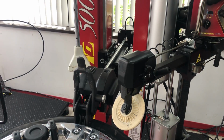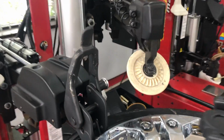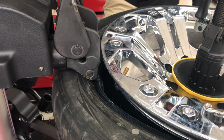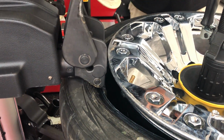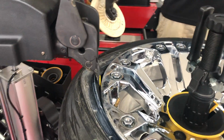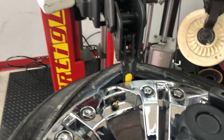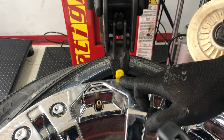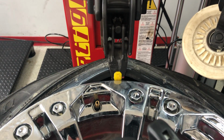catching that bead. If you don't catch it just by going down, you can always rotate, and that will help, again, the bead getting caught in it. After that, you release it. Now you see our finger is back to perfectly vertical. We can start raising. Now, one of the most important parts when you use this machine, you have to reach that red line and go past it before we curve the finger. That's how this machine is touchless.